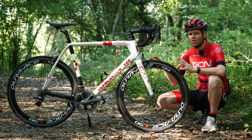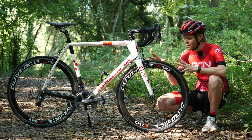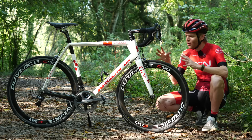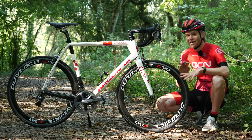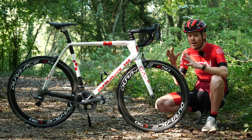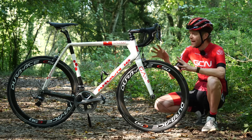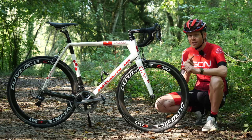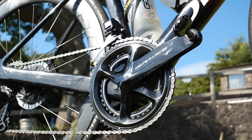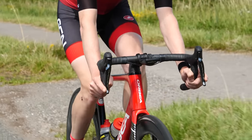This generation of Dura-Ace came out in 2008. 7900 was also the generation of Dura-Ace that introduced us to Di2, although that came out a year later in 2009. And initially, a lot of the pros weren't convinced by it because it was heavier than the mechanical groupset we have here. Although, an interesting note is that current Di2 groupsets are actually lighter than their mechanical counterparts once you factor in the housings and the cables.